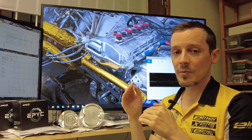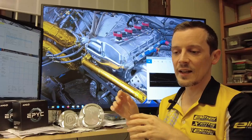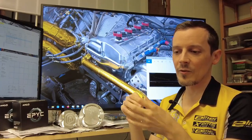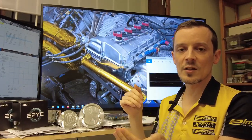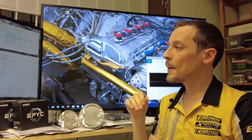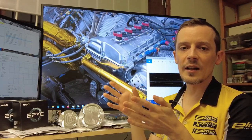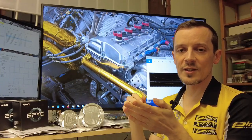It's definitely possible to have a positive ratio depending on how well your intake and exhaust flows, how well the cylinder head flows, and your valve timing. You will always have flow losses in the system, so it's not just the intake-to-exhaust manifold pressure difference you're looking at, but what kind of pressure you have in-cylinder. Engine tuning is important — what ducting lengths you have, how those are tuned for the engine RPM range, and how this works with the valve timing.